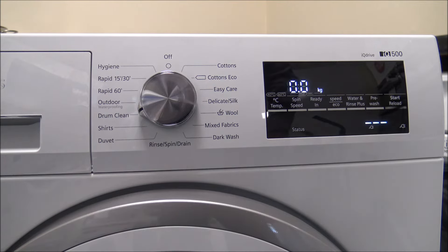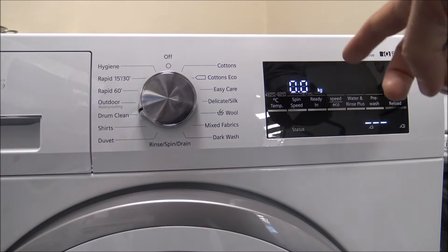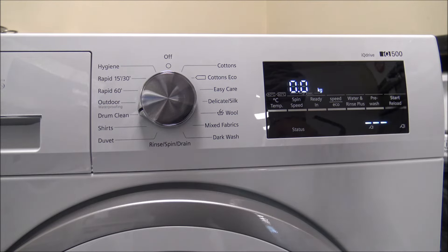The drum clean is something that quite a few people ask about. Basically it's a program designed to clean the drum — as it says, don't put anything in, just make sure you put some detergent in, normally about half the dose you would normally use. It takes just over an hour. The reason they include this is that a lot of people are washing at much lower temperatures — 20, 30 or 40 degrees — and not at the higher temperatures of 60 or 90. Washing at lower temperatures isn't cleaning the machine as it should, so this program washes at a higher temperature to give the machine a really good clean. They recommend doing this about once a month, depending on how much you use it.